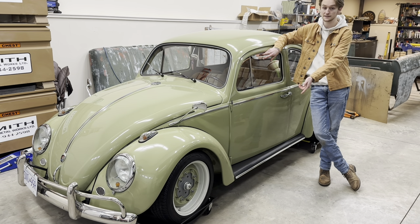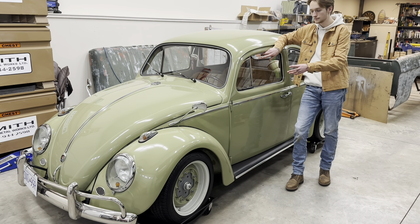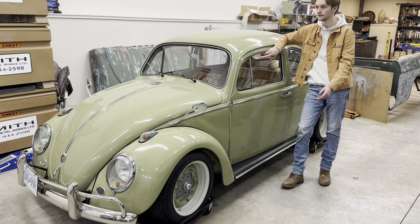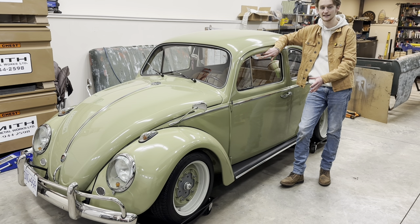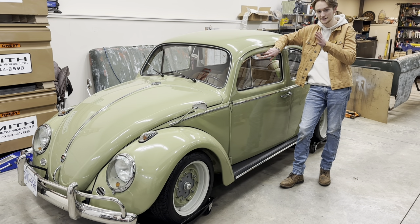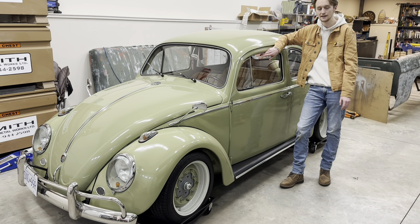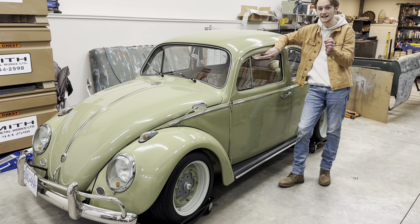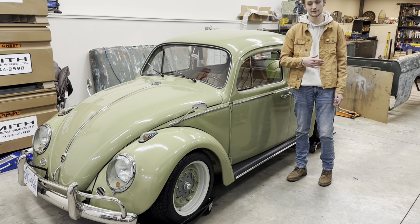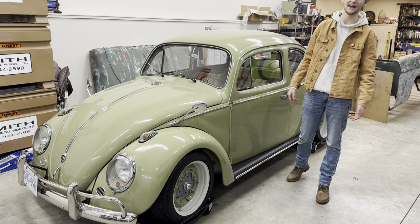I want to make a video about how I picked my wheels and tire offset because I've had a few questions about that, so I'll be doing that soon. The next video will be about the body filler — I know some of you are probably like, don't use body filler. I know to avoid it. I did the metalwork as best as I can to get the perfect body shapes, but the reality is if you don't use just a skim coat of body filler to fix that last little bit, you're not going to have a very nice finish. I don't have any body filler on this car that's over like a 32nd thick — it's a pretty thin coat in a couple of spots. So if you're new, check out all the other videos and my playlist. Thank you so much for watching and I'll catch you in the next one.